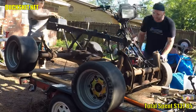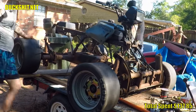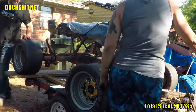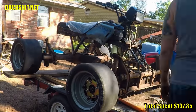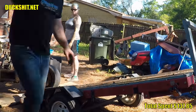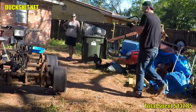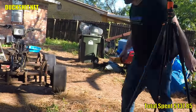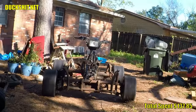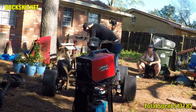B was quick to help me and we tossed together this monstrosity. The crazy part is it just fit with minimal modifications - I trimmed only a few little bits from the Honda frame. If I had cut the chassis any longer or shorter, either the steering wouldn't have reached or the rear section of the Honda frame wouldn't have lined up with the torsion bar. I felt it was important to weld the frame to the torsion bar rather than to the sheet metal tunnel - it's much stronger there and just made a lot more practical sense.